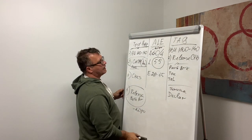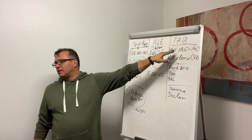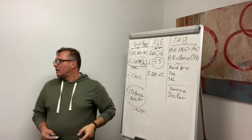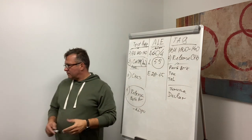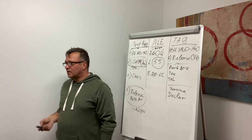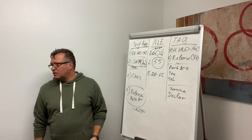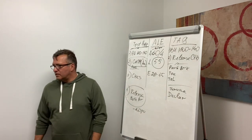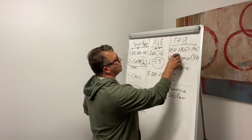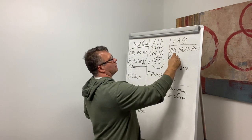Then, what do we do? Tug test, building up pressure. How many times do we build up pressure during the test? 3 times. This is number 3. Okay, the total is 3. We're building it up for what? To have pressure or to hear the sneeze? To hear the sneeze. We don't care about pressure. We're just saying, okay, it sneezed, it cuts off between 120 and 140, but it's all about sneezing and pressure. Remove chocks when they say release. Remove chocks.